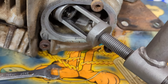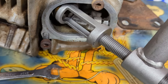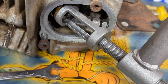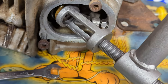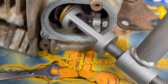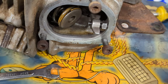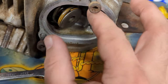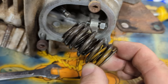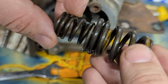Make sure to keep these together as a pair. This is the exhaust valve — I've already done the inlet just to make sure the process works before I showed you — and so I'm just going to gently unwind this now. In the box of the impact driver to my right I've got the two side valves laid out together so that we know which parts came from which. Be careful with valve springs, they're fairly meaty. We've got two springs here — we can see on the bigger spring the closer coils are on the bottom, and they are as well on the smaller spring.